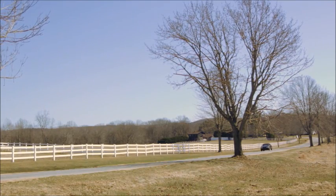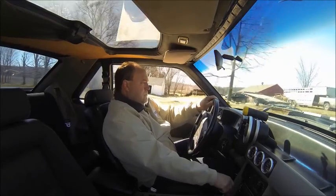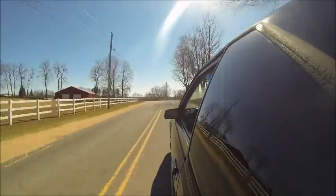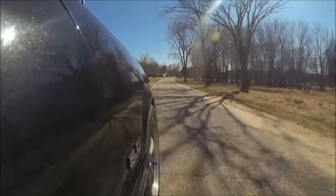So here's our finished product. Despite the fact that the combination of engine parts could not be worse, it actually runs great. What do I mean by a bad combination of parts? The lower end in this engine is completely worn out. Compression is down to between 105 and 130, and the amount of blow-by is incredible.